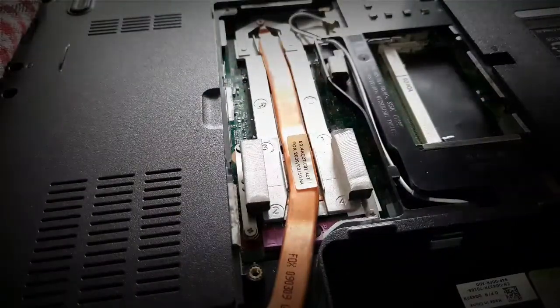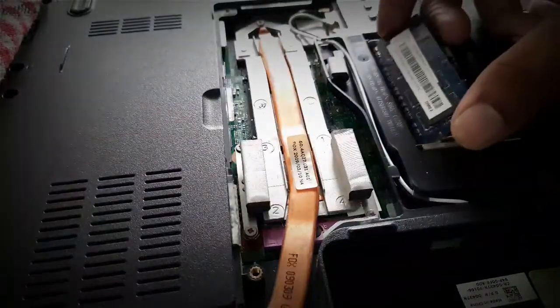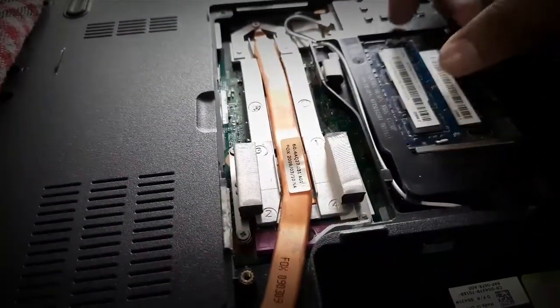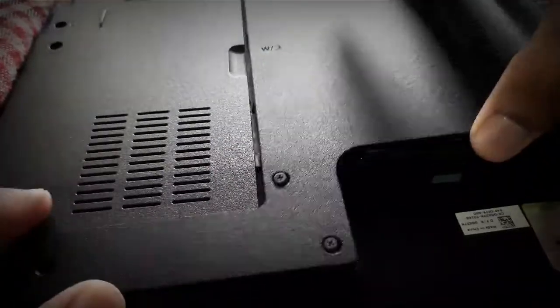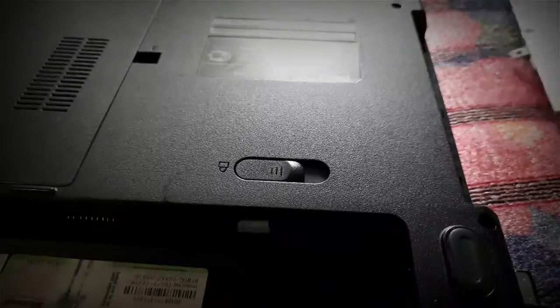After that, you have to insert your RAM back in place. For inserting the RAM, the first RAM slot is right here — just push it in. Very simple. After that, the second RAM slot — just push it in. Make sure it is completely locked in place. Just push it and after that it's in place. Then put the back plate on top. For some of you there may be a hard drive inside — for me it's outside so I'm placing it now. Tighten all the screws up.